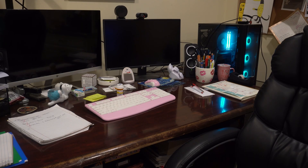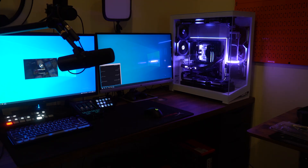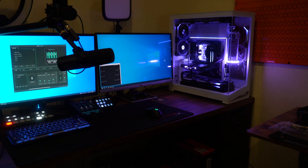Silent — it's never going to be 100% silent. You've got fans moving air, you've got heat. Building a rack like this, you have to make concessions. There's just no way around it. Used server parts are generally going to be out. You can't have delta fans screaming at 10,000 RPM under load. This is my office, this is where my wife works from home, I edit videos, I play games — I can't have delta fans screaming in the background. So you have to make concessions on the equipment that you use.